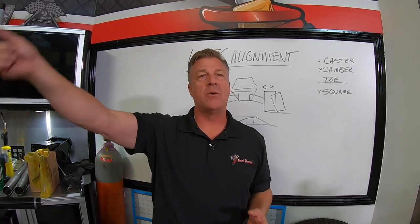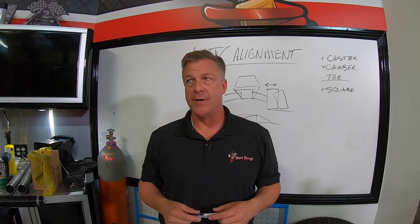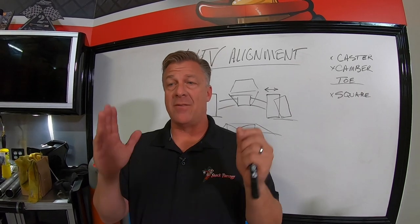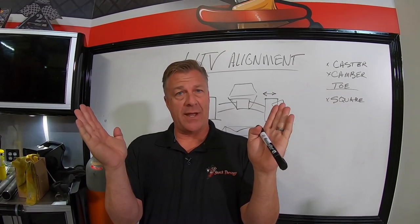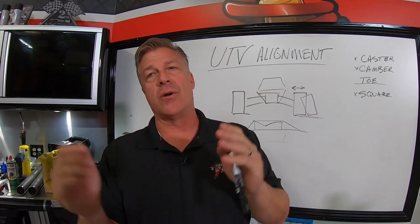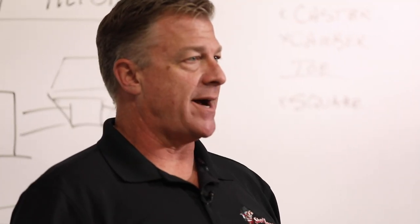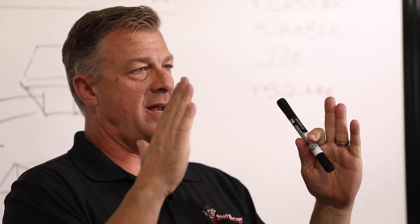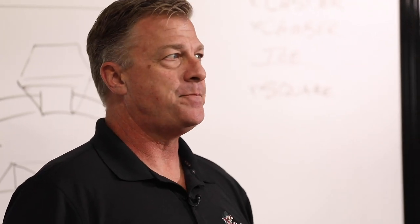And we will go and show you a radius rod kit on one of the cars that are over here and show you how to adjust that. But that's important. It's actually very important because the car in the back, if the tires are leaned out with negative or positive camber, you enter a corner and it just slides off the outside corner. Also, you don't have very good traction when the tire isn't laying all the way down, flat contact patch, and a little bit of negative when you enter the corner is going to turn a little bit better.